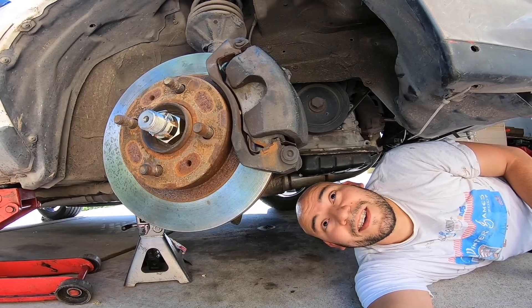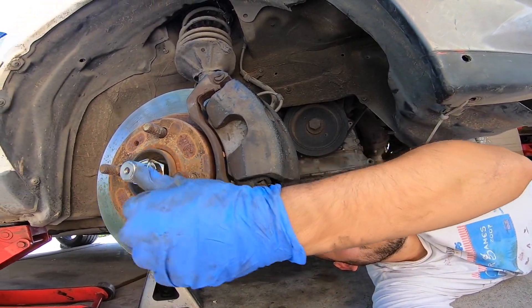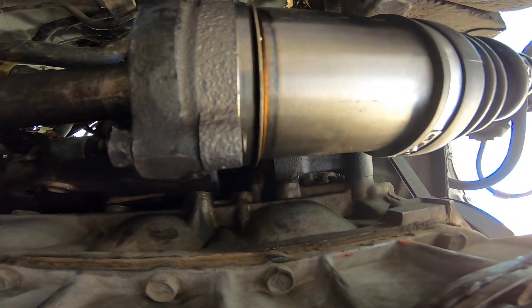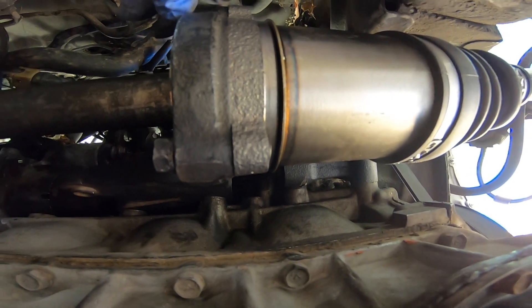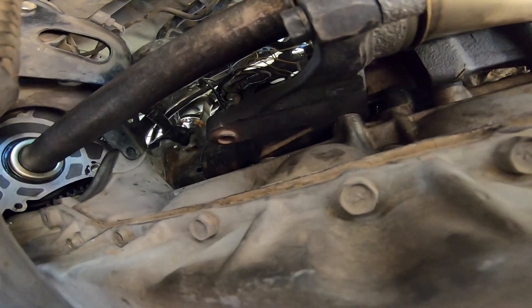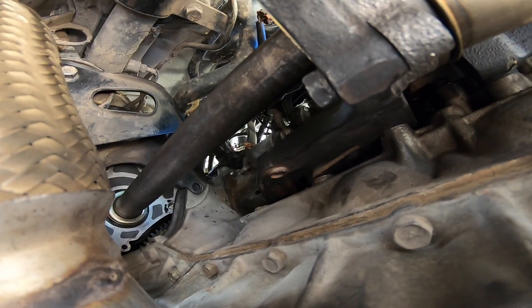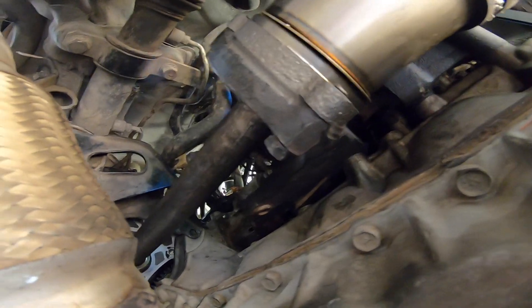The axle is on. The cotter pin's in there. Top strut bolts are tightened. I was able to close this gap after I finished everything up — just keep going around and you'll slowly see the gap close, but you have to keep working yourself around the three bolts. Don't tighten one too much, because you may tweak it sideways and strip out a bolt. The only bolt that's missing is the one I could not line up when installing the transmission — I double-checked and it's still not lined up right. So one bolt pretty much did not go back on during this entire swap.